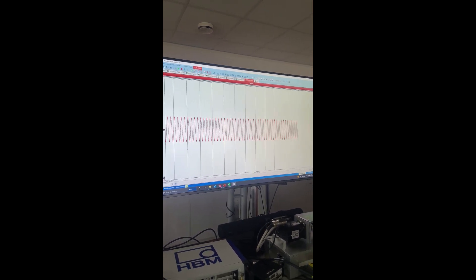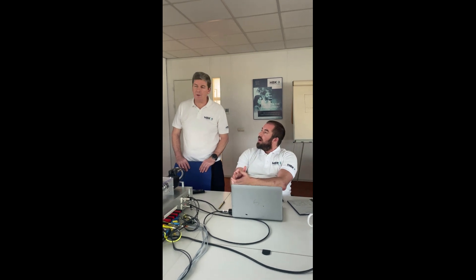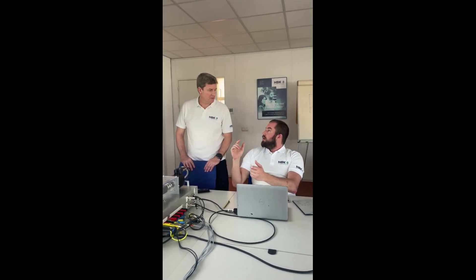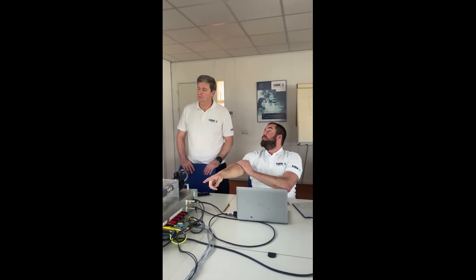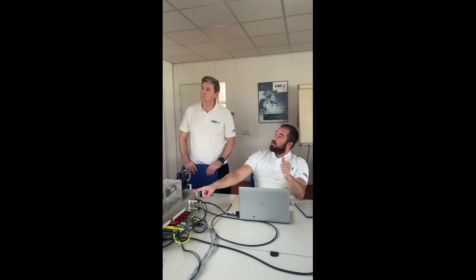So why is that good? Well, going back to the efficiency map — every point, we're just there. Is the competition doing that too? No, because we do it in real time — we do it in the hardware. Boom, you have results. We stream them out on CAN bus. We can receive triggers from the dyno. The dyno's settled. Trigger. Measured. Move to the next point.